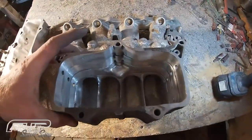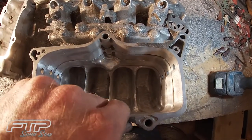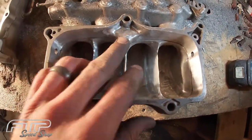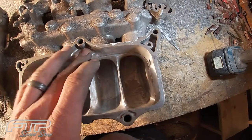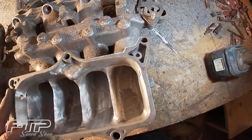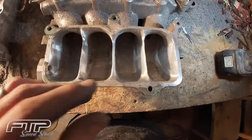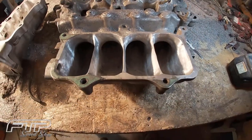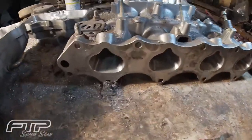For the plates, I got those all smoothed out. We'll get those welded and I'll come in and do a final smooth so that all of these line up really well and everything flows well. The bottom plate — I left that lip right there so that we didn't have a vacuum leak, and it should seal up really well and help that air transition. The lower intake plenum — we've got everything opened up and got these knife-edged so we should have good airflow across those. We gained a ton of plenum volume in this middle area of the intake, so hopefully this will help pick up a couple ponies now that the motor is going to be breathing harder for those stage 2 cams.